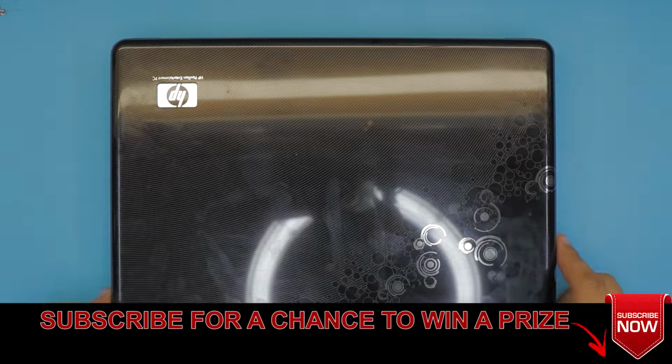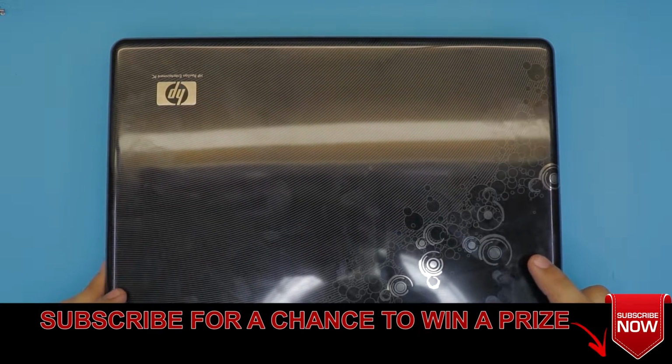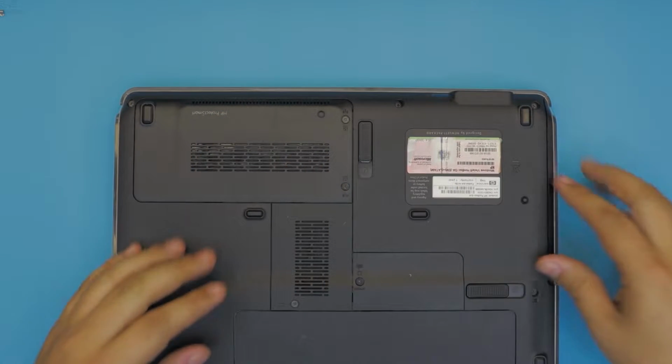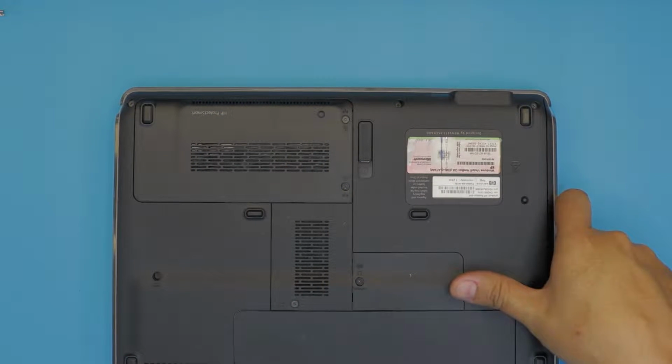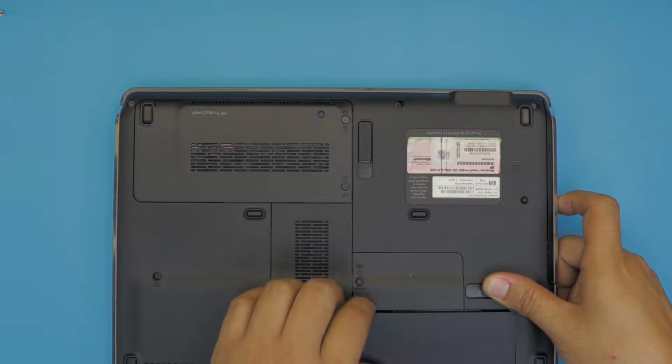I'm going to show you guys in this video how to replace or upgrade your hard drive for your HP dv4 models. First thing first, you want to flip the laptop over, remove the battery by pulling the slider right here to the CD-ROM side and lift up the battery.